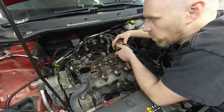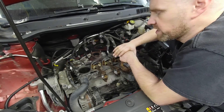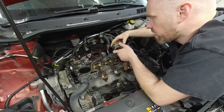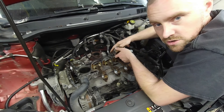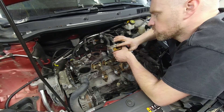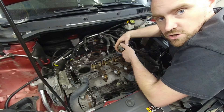The top ring was way tight — like 10 thousandths. Normally, stock rings end up over the minimum ring gap without any gapping whatsoever, so it's usually straightforward and you don't have to do anything. But on this engine, I actually had to gap the top ring and set it at 14 thousandths. As it wears, the gap will grow, and that minimizes oil consumption by maintaining a better seal. Also, you don't want to put the ring gap on the thrust side where the skirts are — put it on the sides of the piston. That way there's less chance of galling or scratching the cylinder wall.